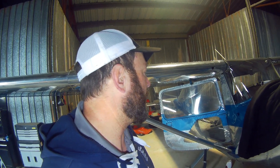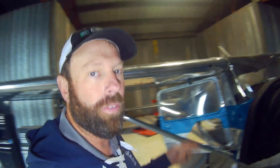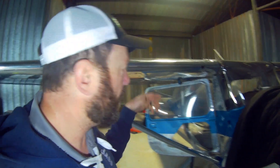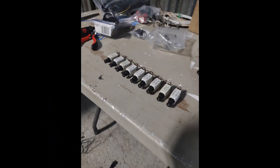I'm too far into it now to turn around so we're just going to keep going. We're making ground - the radio stack was a big one. I really had three major projects: running the tail beacon down the tail - the hard part's out of the way; moving the radio stack up - that's out of the way; and I'm approaching the halfway point on the fuse to circuit breaker conversion.